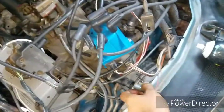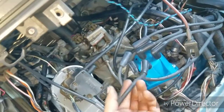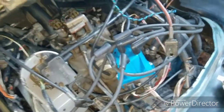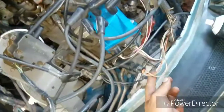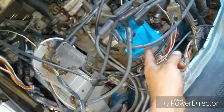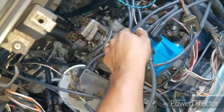If you unplug the oil sensor it'll actually kill the engine — so there you go. If you didn't know that this circuit has something to do with fuel and you were breaking your head trying to figure it out and spending money on parts, well, this can also be your issue. Always check wiring on these older vehicles. On this one the wiring's been pretty good for a pretty old car, so I'm definitely going to replace the pigtail and put a new one on. Check your oil pressure switch, distributor module — or replace the whole distributor — and that's what it's called: oil pressure switch.